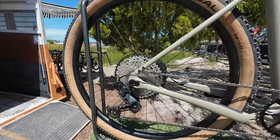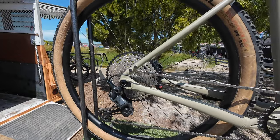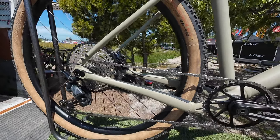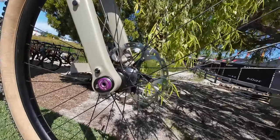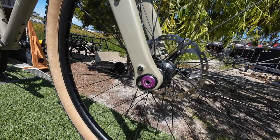Hey, y'all. I'm Brian Zaccone, co-founder of Hudski Bikes, and we are giving a little sneak peek of our new model this year, the Hudski Dualist. It's a Boost-spaced rigid mountain bike using a UDH rear derailleur. It has adjustable geometry, front and rear. So you have two different chainstay lengths, a 435 and a 450 millimeter chainstay. And the fork offset also changes from 44 millimeters to 54.